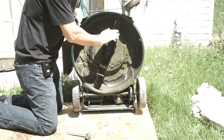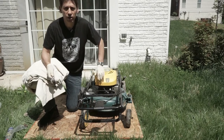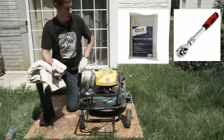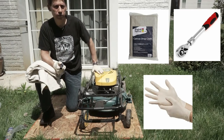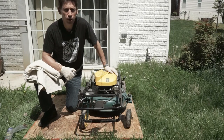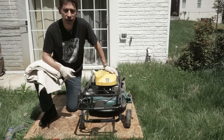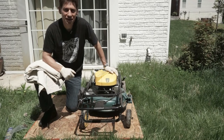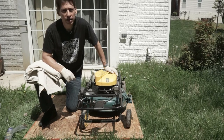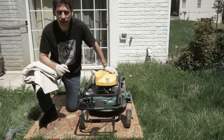And that's it — you've changed the blade for the lawnmower. It wasn't very difficult. You just needed basically three things: a socket wrench with a 16mm socket, a painter's tarp or moving blanket, and a rubber glove or Ziploc bag to cover the gas tank. Flip it up, change the blade, put the new one on. Remember which way the blade is going — counter-clockwise or clockwise for the sharp side — otherwise you'll be mowing nothing. Anyways, I've got to start mowing this lawn. It's already about 1 o'clock. Looking forward to it with a new blade. See you in the next one — have a great day, enjoy your Sunday!